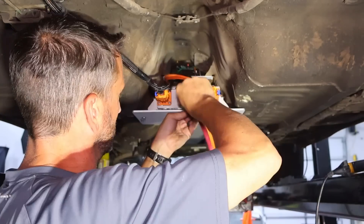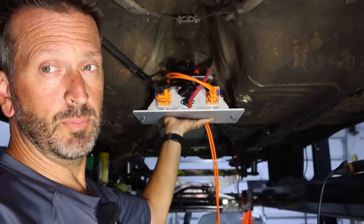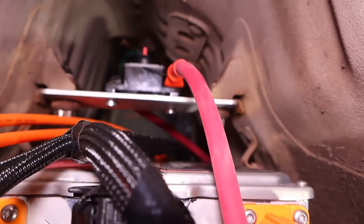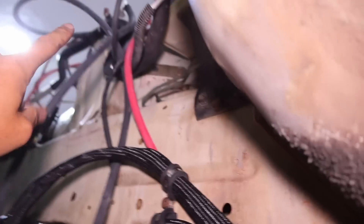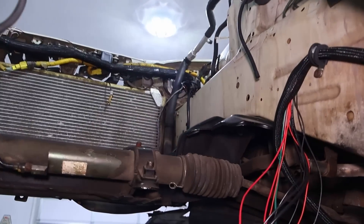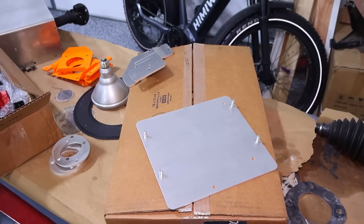In case anybody's wondering, we're planning to cover the entire underside with a panel — like fiberglass or something — so none of this should be affected by road debris. We've got the circuit breaker wired on top, and from there we've got all sorts of wires coming to various spots. The 12-volt DC to DC cables are going up to the battery. Some of the others are just terminated for now — some will go to the VCU, others will go to the BMS which is going to be in the battery box sitting right here. We're going to go try them out and see how well we did.